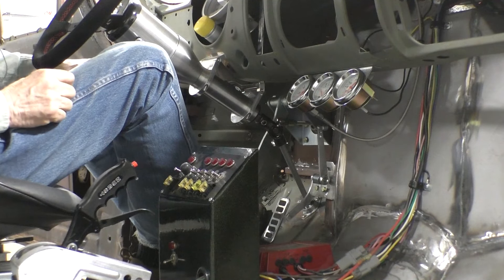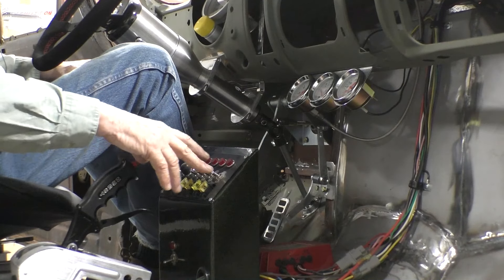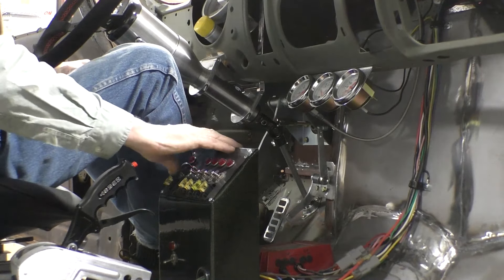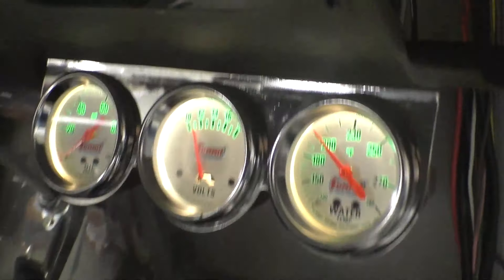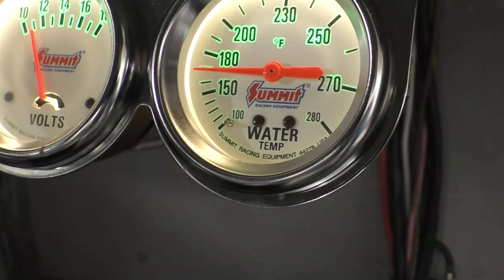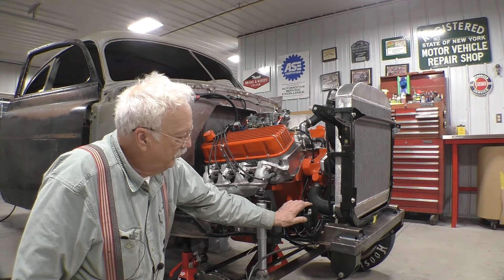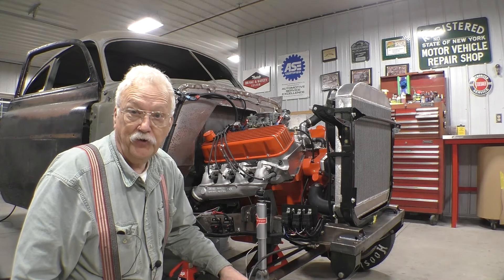Now we could take that temperature sensor out and heat it up with a heat gun, but what fun is that. Let's start the motor up, leave the water pump off, and let the motor come up to 185 and see if the fan comes on. So here we go with the actual test of the temperature sensor. We're going to start it, turn the fan circuit on so that auxiliary fan should come on at 185, and turn the fuel pump on so the motor will run — but leave the water pump off so the motor comes up to temperature quicker. We're at 200 and both fans are running, so it did exactly what it should do. Watch the temperature fall. We set out to upgrade the wiring on the old cooling system and I think we've done that — we added an additional fan. If you enjoyed this video there will be more.